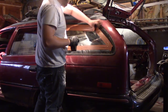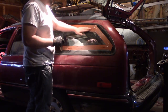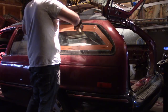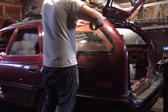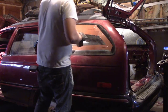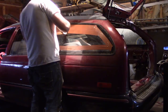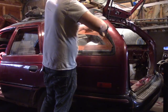This has been the way that I've been doing it for a while. I do this on back windows also in sedans. Side windows I usually take out. I know a lot of guys out there just smash those, like the ones on the doors. I will cut the rivets and pull those windows out, and I usually put them in my recycling bin and smash them so they take up less space, but I do not like constantly having to clean up glass.